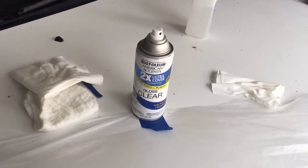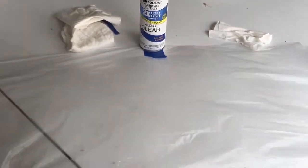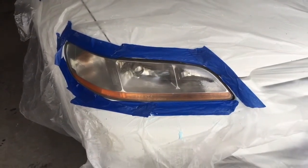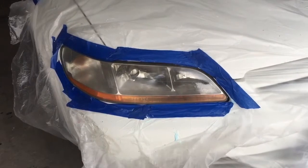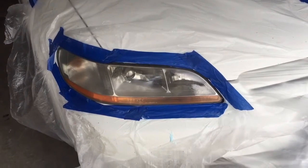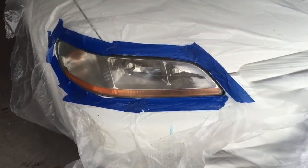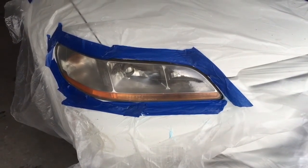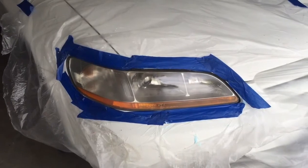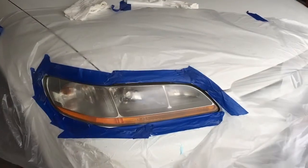As a finishing touch to protect against UV, I just spray this gloss clear, the first coating at least. Look at this so far. When you spray, you want to keep a distance of maybe a foot or a foot and a half, and make sure it's not windy, because the wind is going to mess up your coat. Start out lightly, do not spray a lot, because you're going to get liquid running down, which is why I have to redo it a couple of times. Actually, this is not my first time. It's a lot of finger work. Anyway, I'm going to put a couple more coats. I'm doing my last.